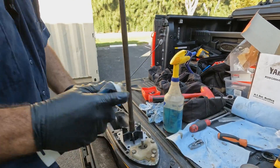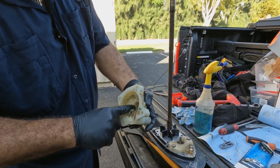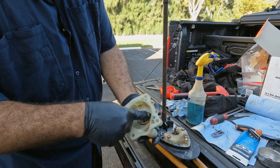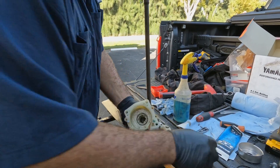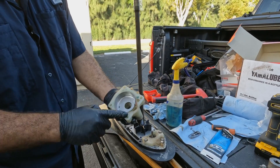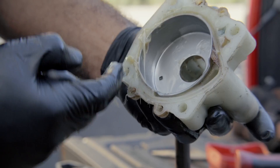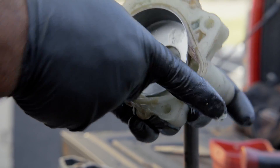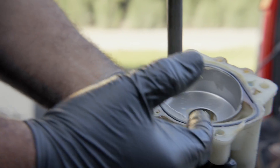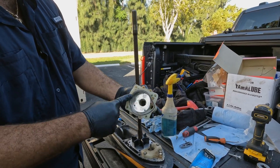Water pump housing — I'm pretty generous again on getting grease in here because this really helps everything stay in place when you're trying to put it on. I'll fill up all the troughs with grease. Don't forget about this o-ring, it's pretty important — it keeps all the water pressure going through the output of the housing instead of through the top where the drive shaft seal is sitting. I'll give it a little grease on the troughs on top. Here's the last o-ring — the grease pushes out but it holds itself in, giving extra stickiness so it doesn't pop out of the trough.